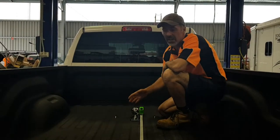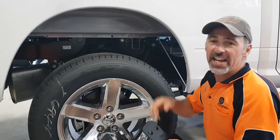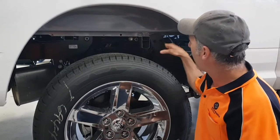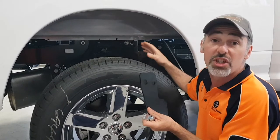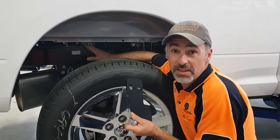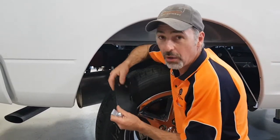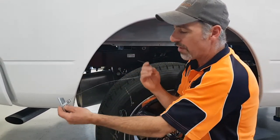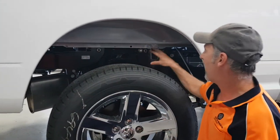That's the spot to mount it in either of the two Ram 1500s available in Australia. Here's some of the bracket install on the driver's side of the 1500. The front bracket sits in there — this bolt goes straight onto the end of the angle iron. The short piece of angle iron is the front bracket rail; the longer one is at the back. This bracket comes all in one piece with a top and bottom bolt that you insert through the chassis. You stick the fish wire in and it pulls that bolt out through there.